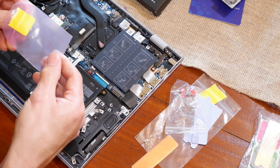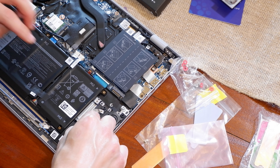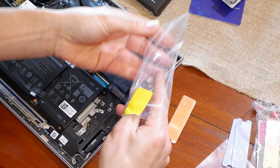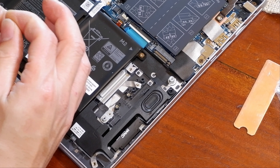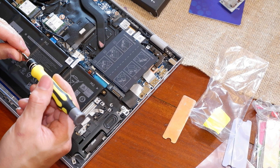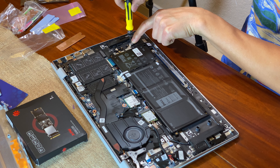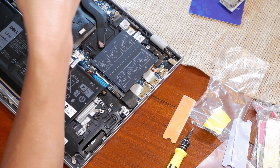So you take the bracket, line it up so the small hole fits where the threaded hole is, and the other threaded hole fits on the plastic nub. Get it lined up and use one of your Dell M1.6 screws. These 1.6s are about 2 bucks each, but with a Dell rewards program they ship for free. This little offset bracket fits right in there, and then your SSD will screw into that hole once mounted.